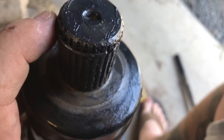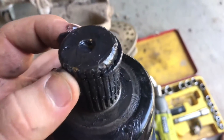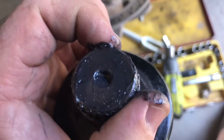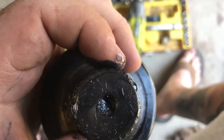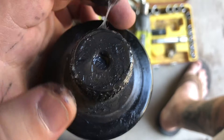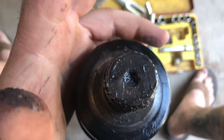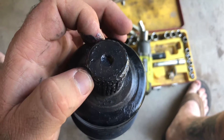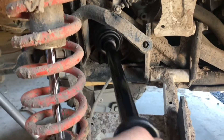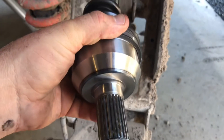Just put a little bit of grease on there. You want to keep that little clip as centred as you can, because if one edge hangs right over and this side's pushed right in, you've got bucklies pushing that drive shaft in there — so keep it as centred as possible. I'm going to go ahead and try and slide it back in. Give it a really good push. If it's not going in, pull it back out and check the clip again because it may have slid over. So I did a nice firm push in and now you can see that little clip's locked in.